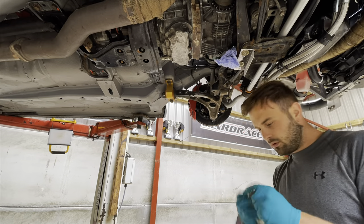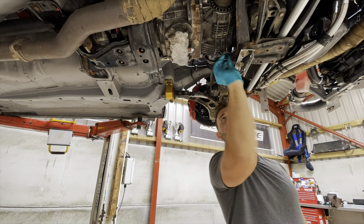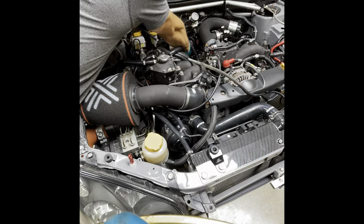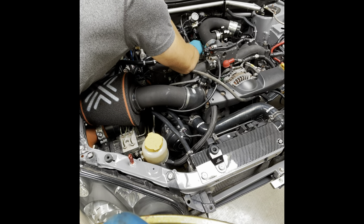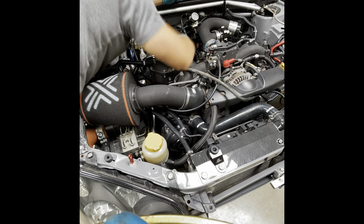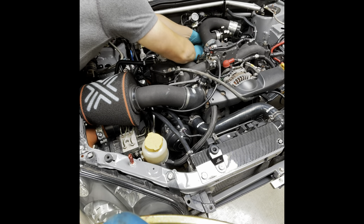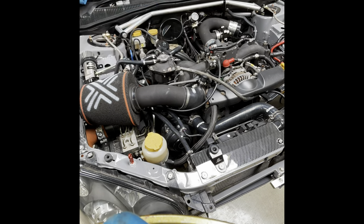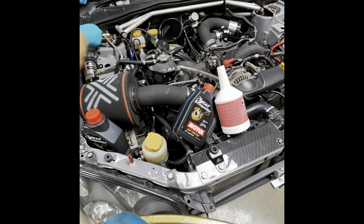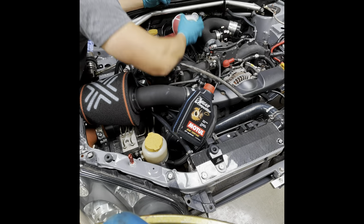I don't know if this was JDM box specific or someone put the wrong sump bung in, but the new one was actually longer — so there are obviously more threads in the bottom of that sump pan. It was snagging a little bit rough so I just took it out and double-checked — don't want to strip anything. I've come up top to put the top gearbox mount on — a billet one. Then just finishing the rest of the electrical connections: the speed sensor, lambda, the connector for the AVCS as well, and then filled it up with the new fluid — I think it's four litres, so I put all four litres in.